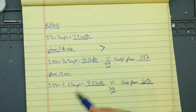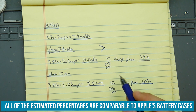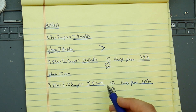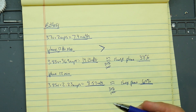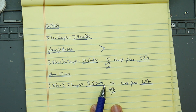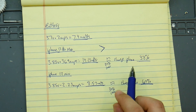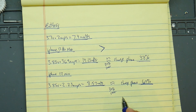There's not really a set percentage of power lost. A lot of research puts it around 30%, though it fluctuates. I've used 30% as a baseline to estimate how much phone battery we can expect to charge from 0%. It's a bit uncertain on these iPhones because Apple has them drain the power source heavily from 0% to around 40–50% and then slow down charging. So assuming 30% loss, you can expect to charge the iPhone 12 Pro Max around 36–38%, and the iPhone 12 Mini around 60%.